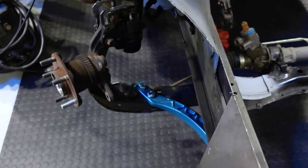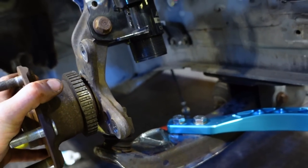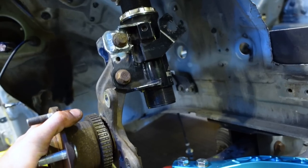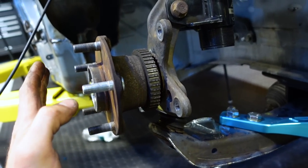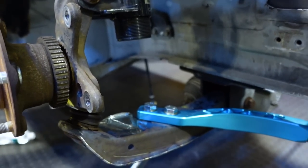Now, I did get the angle kit put together, that OMD kit. Obviously, we will end up powder coating the lower control arms and the knuckles and stuff. We are just test fitting right now, so Collette's going to come over here with some wheels. We're going to put that on along with our giant spacer, and then we're going to swing this thing from lock to lock once our tie rods get here, and then I can actually see to make sure that we have enough clearance.